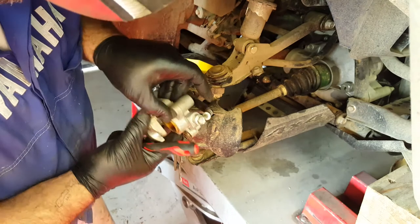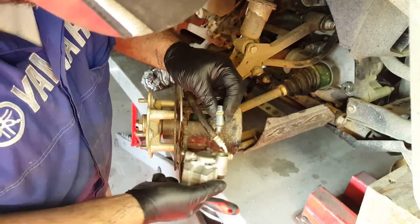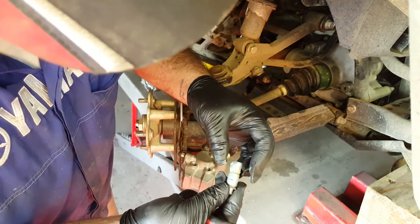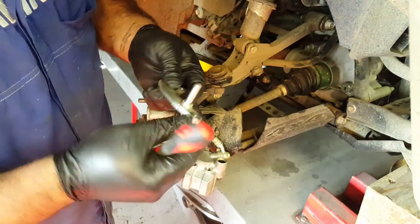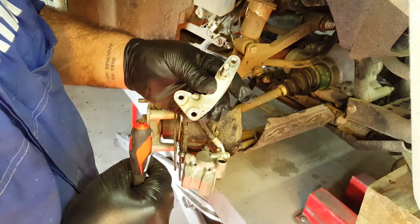We can withdraw that from the back of the caliper. You can see here you've got a grease well — we're going to clean that up, put fresh grease on it, and stick it back in again. With the other slider, all we need to do is give it a clean as well. This one also has the grease well running along it, and we'll put some fresh grease on there and put it back together.